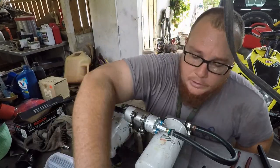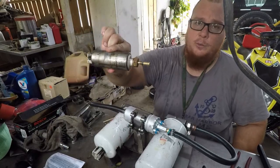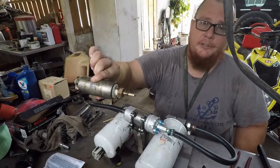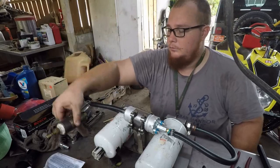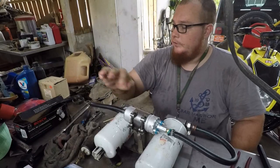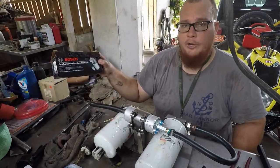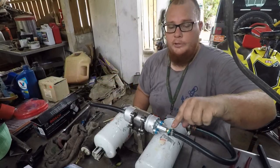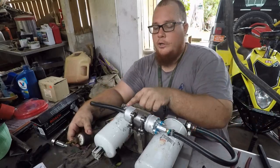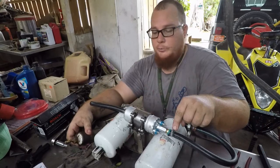Just changed the pump. There was the old pump — the old Amazon pump. It wasn't keeping up with my hot tunes, bigger injectors, and bigger high pressure oil pump. Wasn't keeping up. I upgraded to this Bosch 044 OEM replacement pump. I went out and got a fitting for it — a hose barb fitting. I put a hose clamp on here just to be sure, and over here just to be sure also.